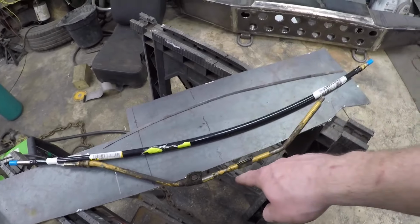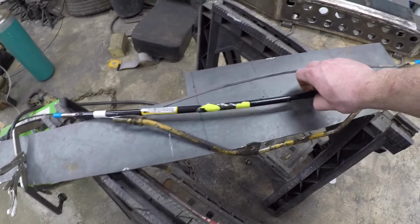So I figured we were replacing the tube anyways, so I looked up the part numbers for the longer dipstick tube. This is also a flexible one, which is much better for what I want to do. That way I can plug that into the hole and then put this end over towards the fender, somewhere you can more easily reach it. Yeah, that's the new dipstick tube. And over here in this mess, we got the new Caterpillar dipstick.